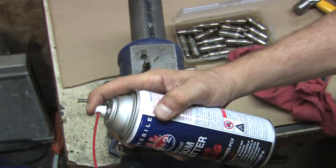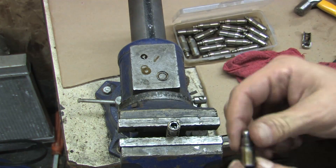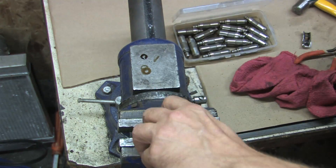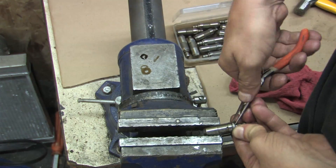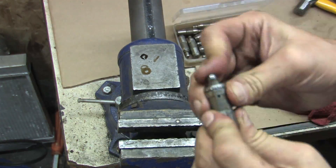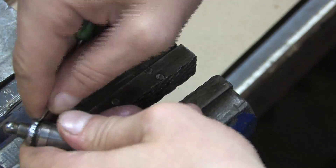After a good soaking, put them all back together the way it was: spring, lower piston, upper piston, cap. The bottle cap ring can be a pain, but if you're careful it will go back on. It's all about the angle that you clamp on it with the pliers — you want a fine point needle nose and to bite down under the lip until the cap is snugged. One down, 15 more to go. It's at this point when you realize that third revision lifters are less than $90 shipped for a full set of 16 — that's about $5.60 each.